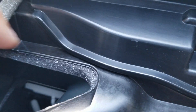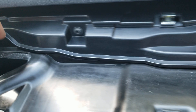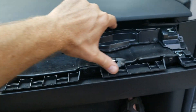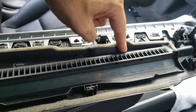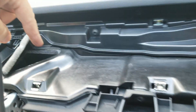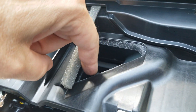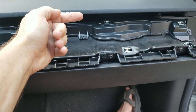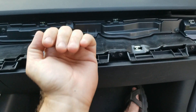The way the system functions: air comes from this cavity here and fills this area like a plenum. This dash panel is lined with foam, and then you've got this vent here that corresponds with those slits right there. What happens is air comes in through this slot and is controlled by that butterfly door for more or less air, filling this section as a plenum.